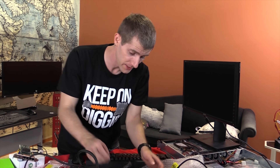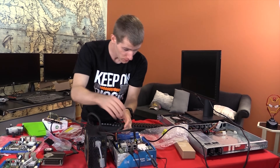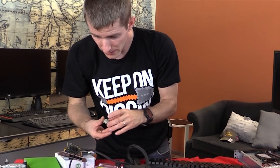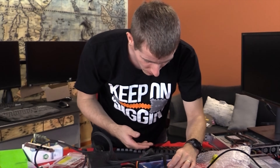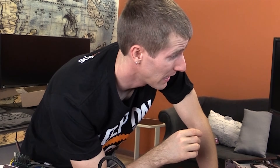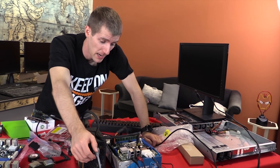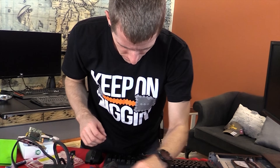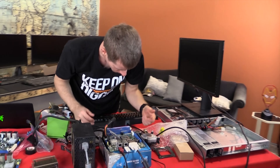I'm starting to think we've got a dead board on our hands. I can try a different stick of memory. We have a POST — she's a little picky on the memory compatibility, but this is good news. Now let's try our Xeon chip with that RAM and see how that goes. I think we may have not only killed our board but also killed our CPU and RAM, so we're going to the 2600 and the full-height RAM. Even though that's not really going to work for the final build, I'm going to give it a shot.